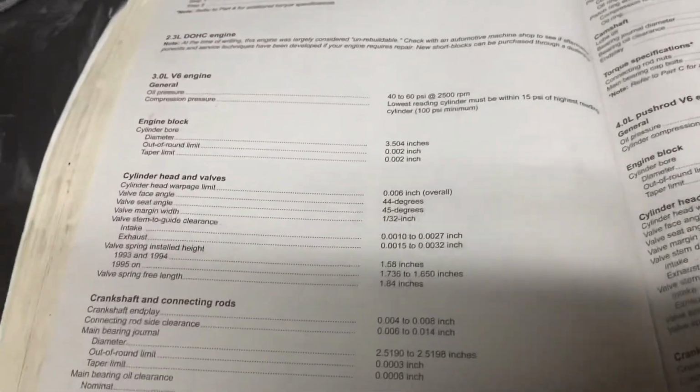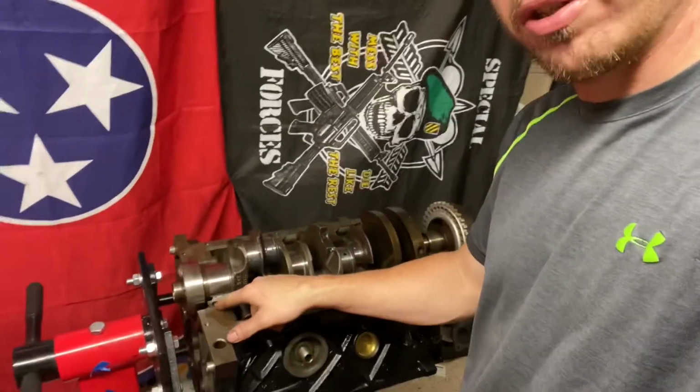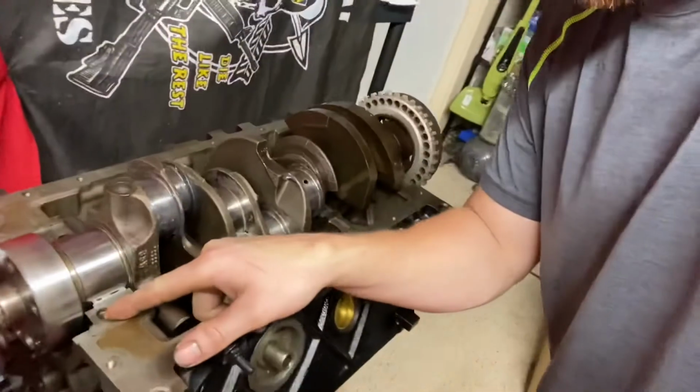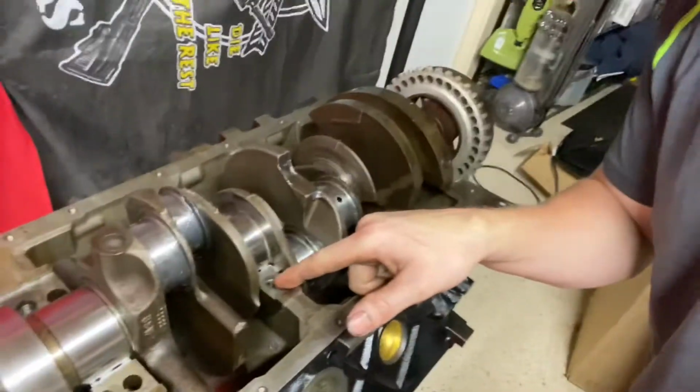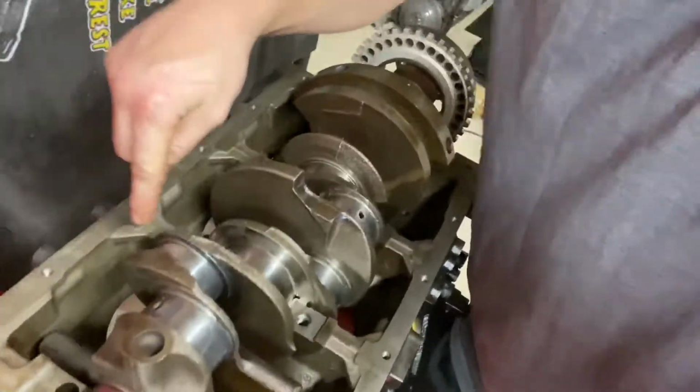With that, we're gonna wipe off that plastic gauge. Things might give you a false reading, and that's the reason why you wanna make sure that you got all the grit out of each one of these little bolt holes for the main cap, right? If you're screwing a screw in, you feel a little bit of crunching, you might want to go over it again with a brush or something like that, just to make sure you don't have extra oil that's in those bolt holes that's going to cause the torque to get thrown off.